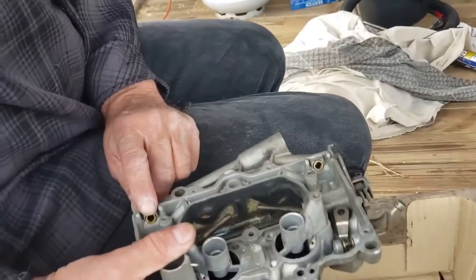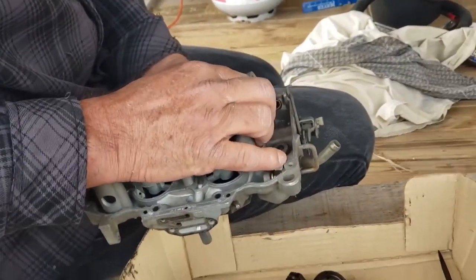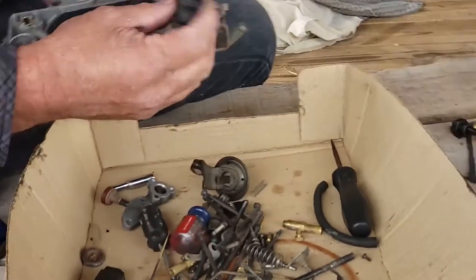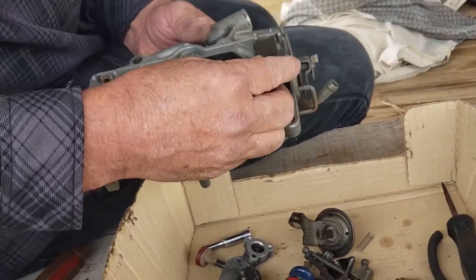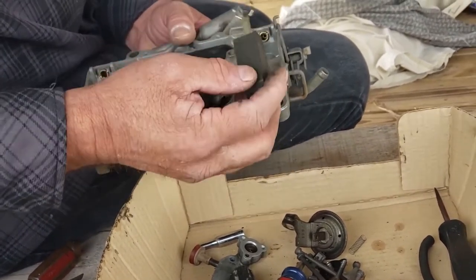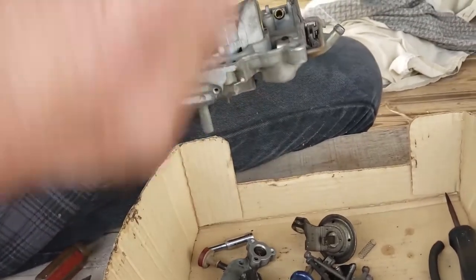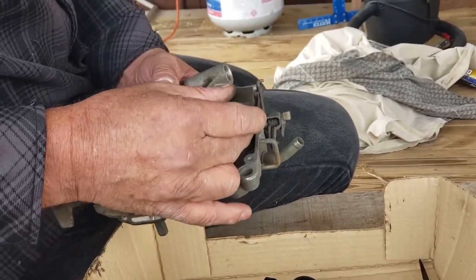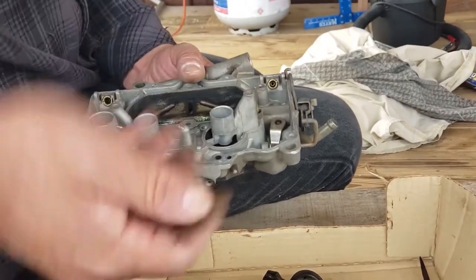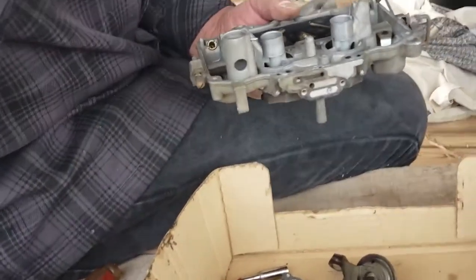I have seen these come loose while the car was going down the road. In fact, the Little Red Express, when I was driving it home, the seat came loose and started to back off. Well, when the seat comes loose, fuel leaks around it. So eventually the car floods. But that seat sets how high this float is sitting. And so if the seat starts coming out, the float starts going down. Well, it doesn't fill the carburetor all the way up. And pretty soon it holds the fuel from coming in. And the car starts running like garbage, like you're running out of gas. Well, you are running out of gas, but the fuel pump and everything is good. You just can't get fuel into the carburetor because the seat is falling out. So then after it idles for a few minutes, pretty soon the fuel leaking around the outside fills up and floods it. And then it goes the opposite direction, like too much fuel. So make sure them seats are in there good with their little gaskets.